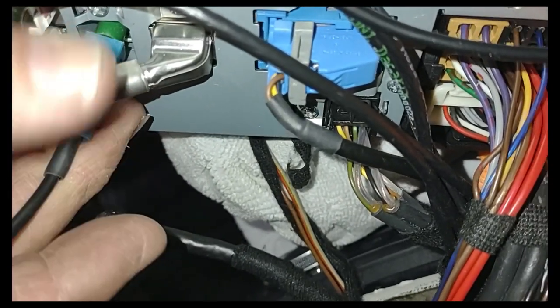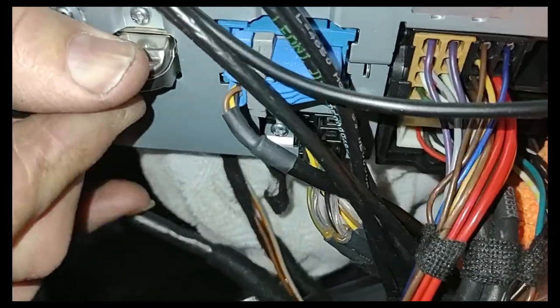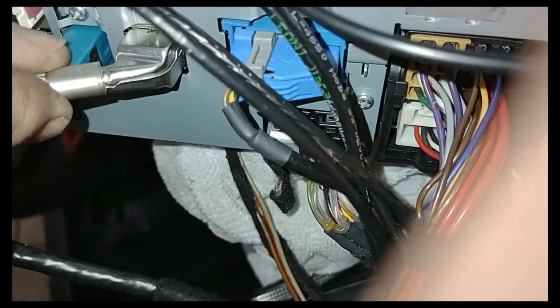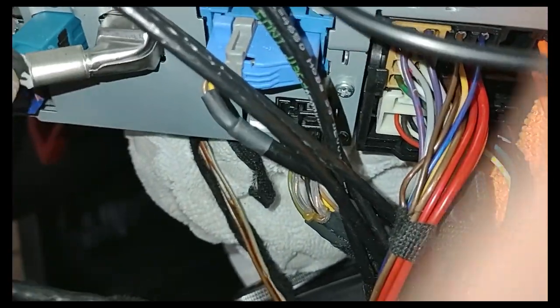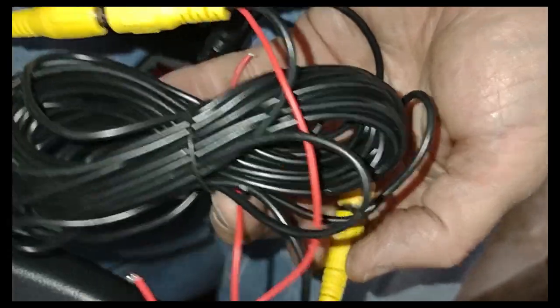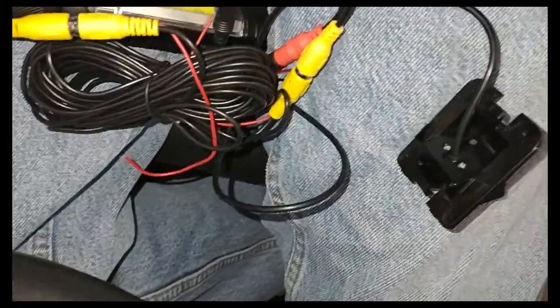The video cable plugs in here. You might actually have to unplug this one — my recollection is this one does not have a release, but it's just really, really tight. I'm going to plug this in and then plug this back in so everything functions as it should. There will be a little bit of interference, but once it's all in place, I don't think that will really matter. Now I'm going to hook up the power to the blue wire temporarily, to ground for power, then plug the radio unit into the green connector. I'm using the extension because I don't want to find out after I've run this all the way through the car that there's a problem with this cable — hook it up as you're going to install it, then test it.